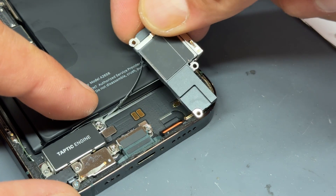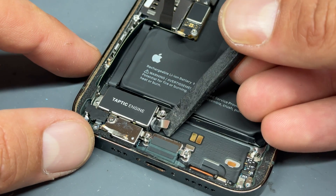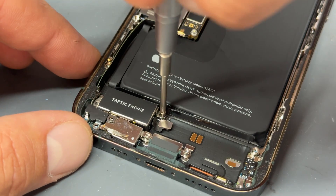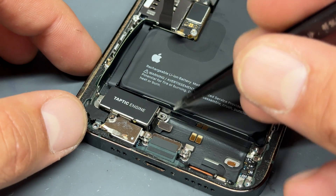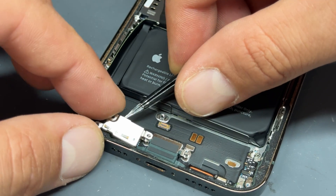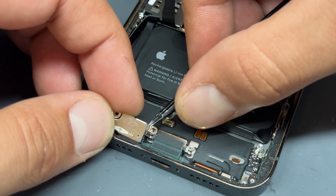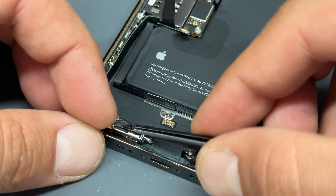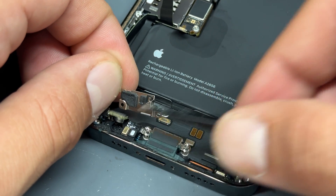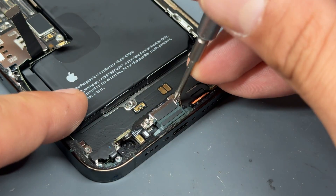You should now be able to remove the loudspeaker from the chassis — it's stuck at the back with a little bit of tape, just peel it back and store it safely for later. Now we'll go for the taptic engine — that's held down with an FPC connector and one standoff screw in the top right. Remove that to get it out of the way and store it on your magnetic mat. Then lift up this shield — there's a little clip in the bottom right corner that makes it a little awkward to get out. It's also stuck onto the back of the barometer sensor so there may be a lot of resistance — just give it a little tug.